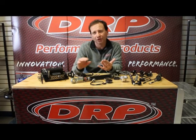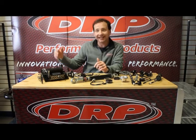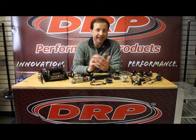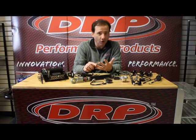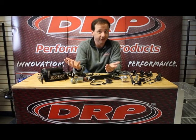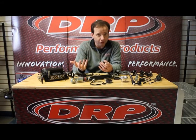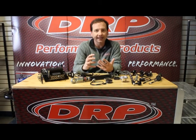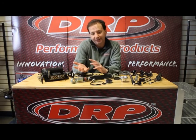The 13-channel system works the same way, but it does come with a battery pack and will already be configured for additional sensors. If you're planning on having all the driver inputs — steering, throttle, and brakes — you're going to want a 13-channel system. You'll definitely want your four shocks, and in a dirt application you'll want four shocks plus a fifth coil or pull bar, plus your driver inputs. That puts you over five channels, so go with the 13-channel system.